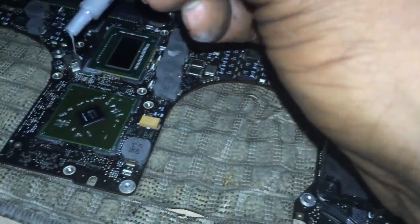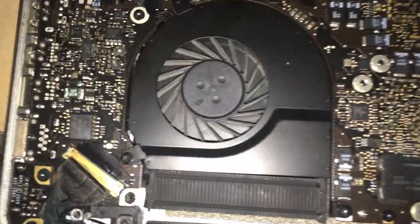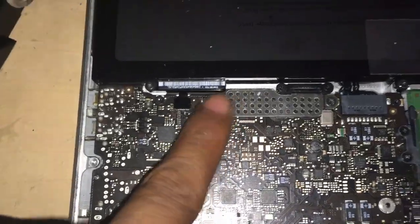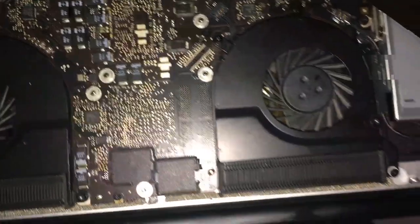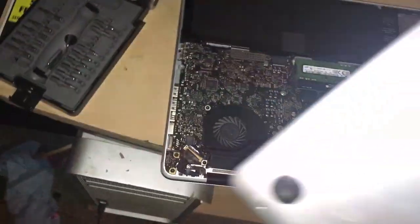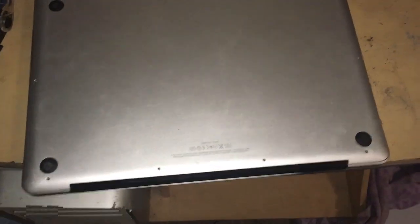Now I'm going to hit it with a little bit of thermal paste. All right, we got the board back in. Got the power connected back, battery back on there. This little bracket — that was a bitch to get off, but it was actually easier to get back on. I'm going to go ahead and put the back cover back on. Remember, these long screws go in the first three holes.